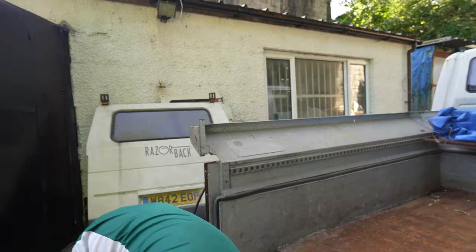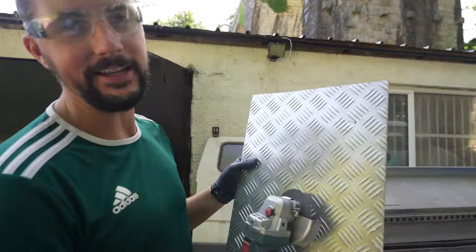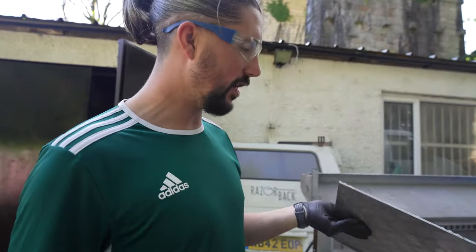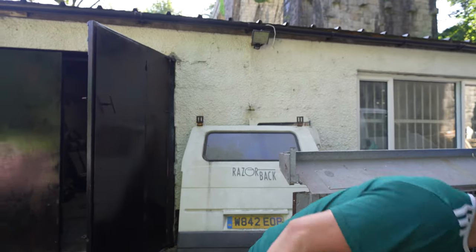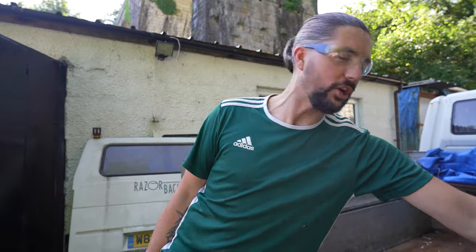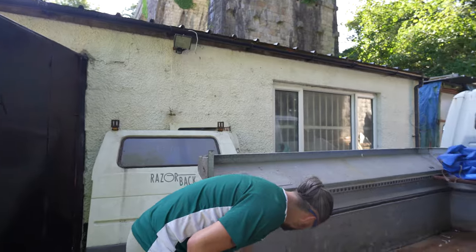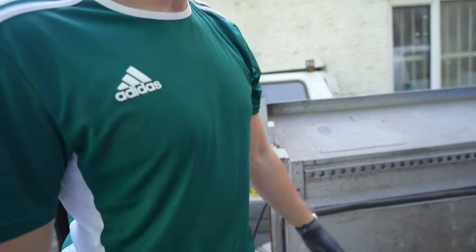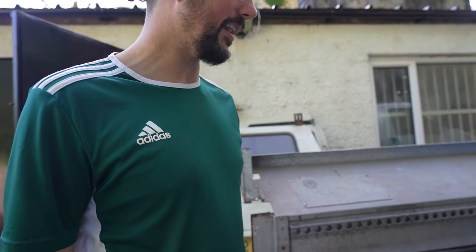After sealing up the ram, I thought I've got to move on to something else - it's such a nice day I can't just sit and chill. I'm going to try and get rid of this old floor because I'm going to replace it with some checker plate. For any of you who don't know what checker plate is - this is what it looks like: extra grippy aluminium, about 4 mil thick. That will go in there nicely and run all the way in. I think it's only about ten rivets holding the floor in - take them out and the floor should start to peel up, and we'll see how bad the actual flooring is underneath.